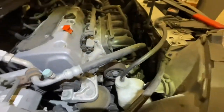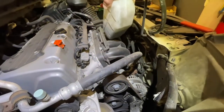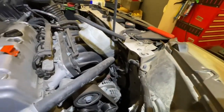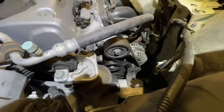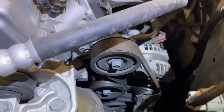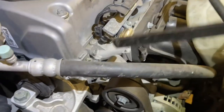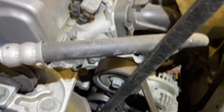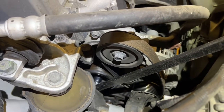The first thing I'm going to do is reach down in here and pull the coolant reservoir up out of the way. You can literally just slide this up and set it leaned up against the intake manifold. Now we've got good access to the serpentine belt tensioner right down here. That's a 14 millimeter — I've got a 14 millimeter socket on the end of my serpentine belt tool. You could use a box wrench; you probably won't be able to fit a standard ratchet in here.